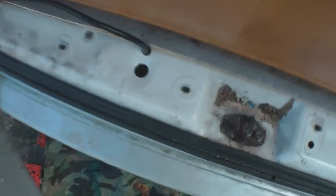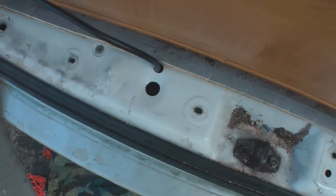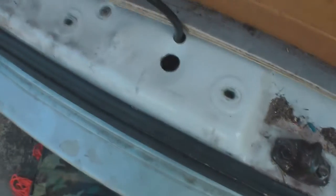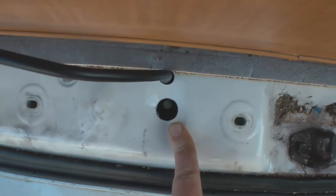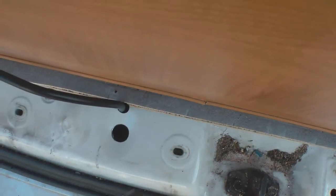Okay, that's the hole drilled. I drilled the hole for the cable as well while I was doing it — I'll still put rubber grommets on here, but this hole's done. It's opened up to 20mm at the top but only 10mm underneath, so this tube will rest on the bottom part of the car body rather than the tow bar.